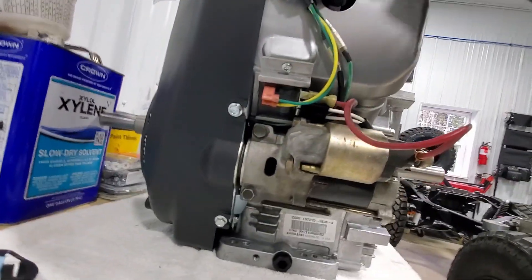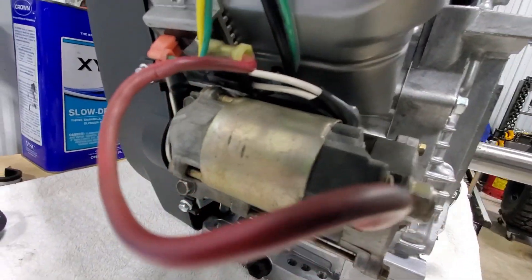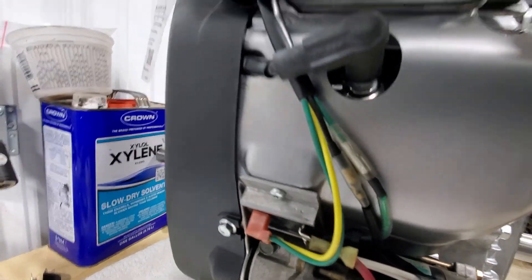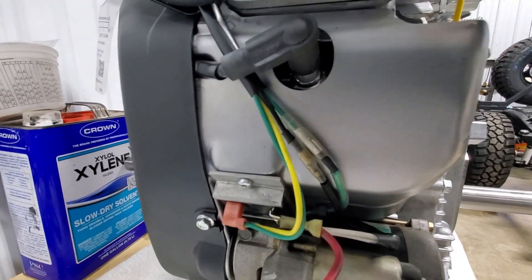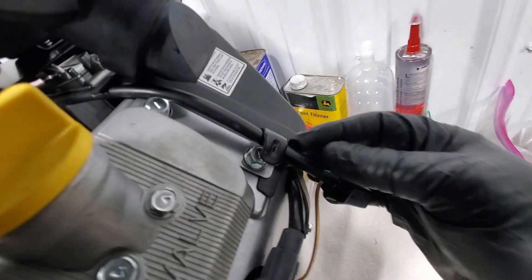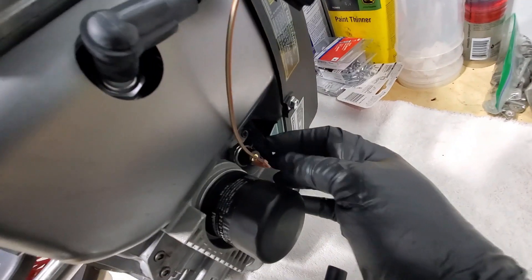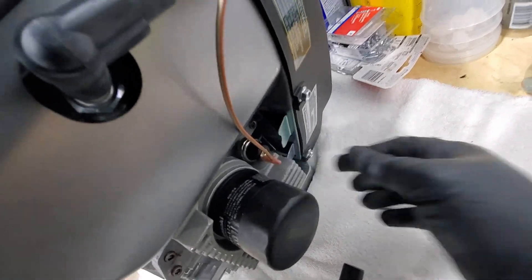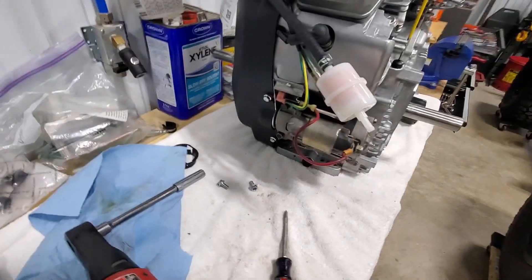The original starter is now in place, along with the voltage regulator. We hooked in the wires from the starter and hooked up the wires that go to the coils. Then we run the harness over — it hooks into these plastic pieces that I took off the original motor. And then we have the wire in for our oil pressure sensor. That's it for the wiring portion.